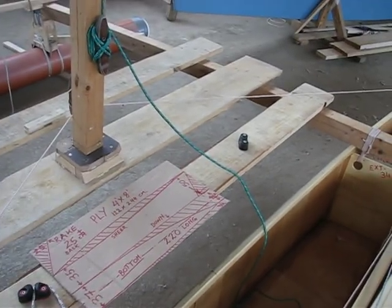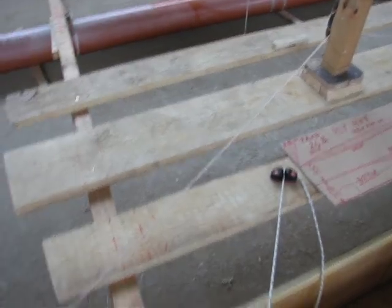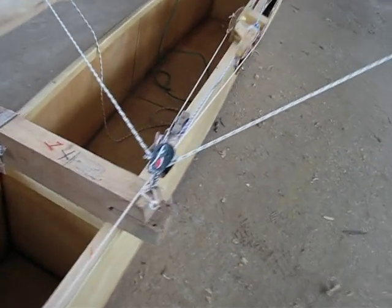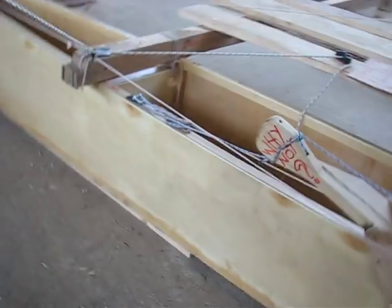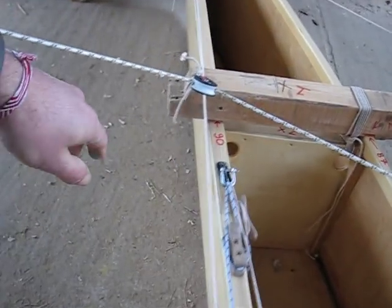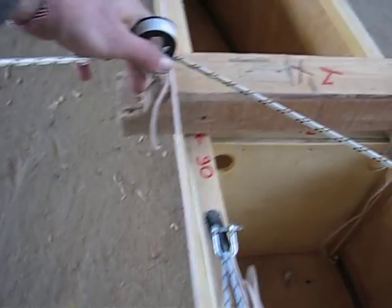Mast step — as stupid as stupid can be, it's not going anywhere. Two screws, two screws, two screws. Got to add lashings over here, one's missing — two lashings everywhere. This is the main sheet, so I just lash a block onto that. The other sheet's not rigged because it's pulling the rig out now, so it looks nice and fancy. You've got two sheets coming from here — these are four-meter spars, and they're really pieces of scrap. This is a piece of rubbish pine, and the other one's a bamboo — just a long straight bamboo I found that wasn't very straight, and I connected a piece at the bottom.